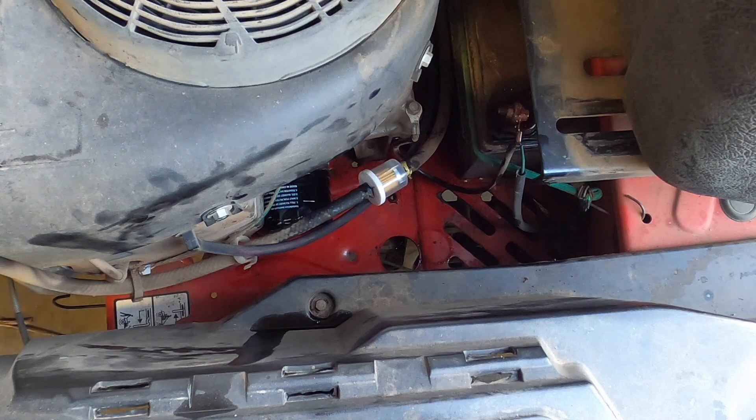And there you have it — the fuel filter is on. Don't be too concerned if when you first put it on it's not filling up with fuel immediately — that's not uncommon. These are not gravity filters; they're meant for a fuel pump. Right now the fuel pump is not running because the engine isn't running. These fuel pumps are meant to pull fuel, and in order to do that it has to have somewhere to put it — right now the carb is full. So it won't immediately fill up. I don't see anything leaking, so we're good to go.